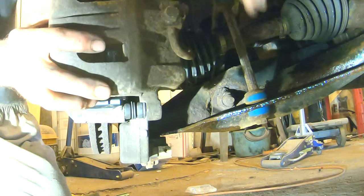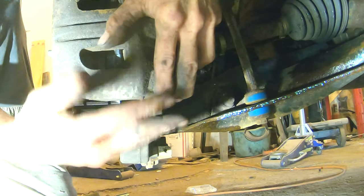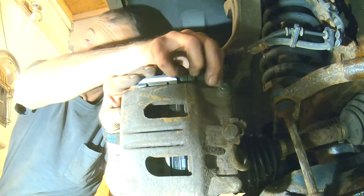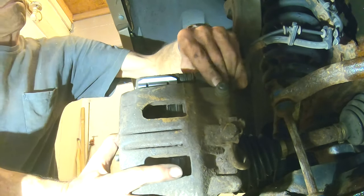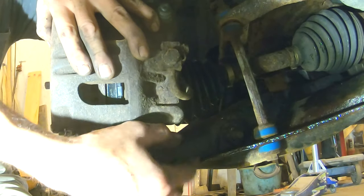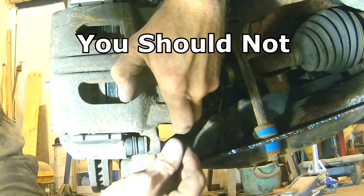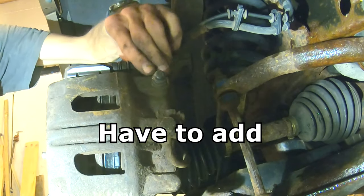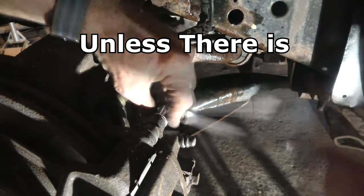Get our pins back there — they wanted to stick a little bit going into place. There are a flat side on them that sits against the caliper on those pins. Once they're in, we'll start our bolts in just as before. It's worthy of mention: looking over here you can see the stabilizer is damp — that is brake fluid. When I compressed the pistons in the calipers, the brake fluid gushed out. What makes that happen is when brake pads go down, the fluid stays in the caliper and less is in the master cylinder. Somebody over time had added brake fluid, and when I pressed the pistons back in it pushed some out. If it's something that bugs you, you can take a little syringe and pull some out of the master cylinder first before compressing the pistons.